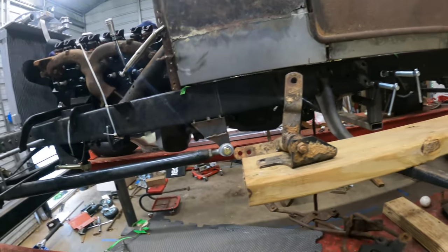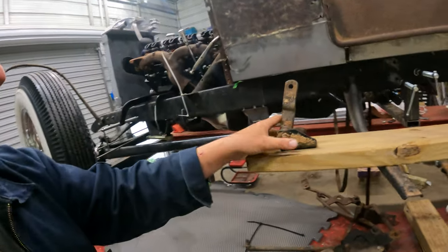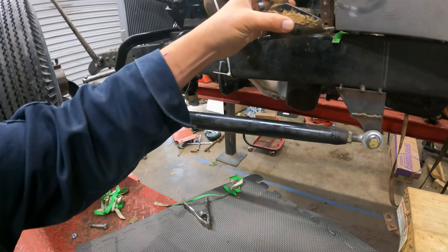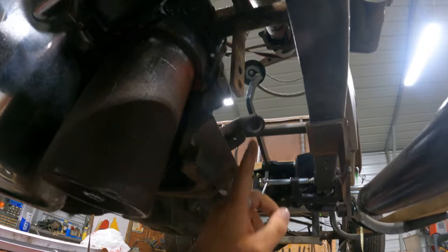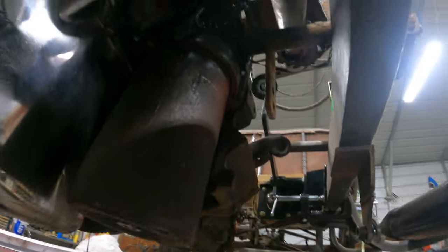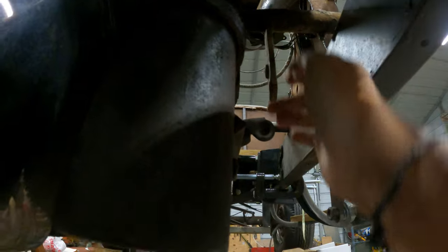So our foot can press this way, which will push a rod this way, which will release our clutch. Now, I'm gonna have to modify this guy, but I figured we could shove it in there and also let it take up space. So it's gonna line up somewhere like with the hole in the block. This is the little doodabber, clutch fork is the correct term there, that will push our clutch back. And as this rotates, right, see? That'll do the pushification.